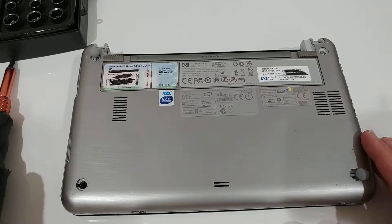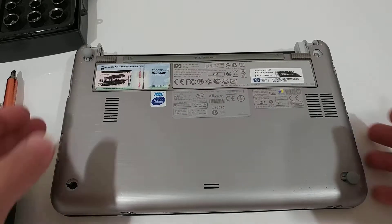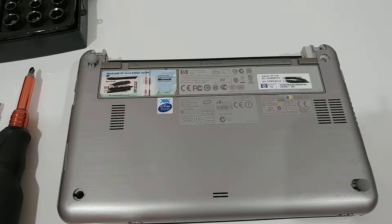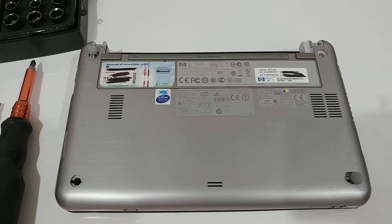That's too much work for me usually. What I typically do is a hard drive and memory upgrade, and you can do both just by removing the keyboard. On the side you'll find the serial number — it might be a Windows XP key, but you should be able to use that to set up Windows 10. A couple of years ago that was still working. If not, you should be able to sort it out by contacting Microsoft support and explaining you had to replace the hard drive.